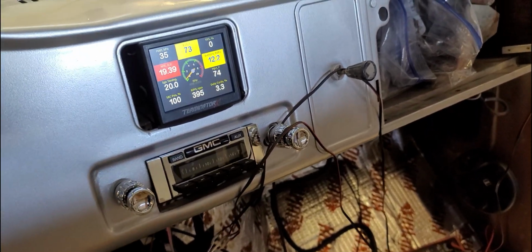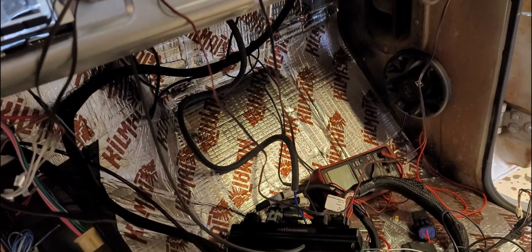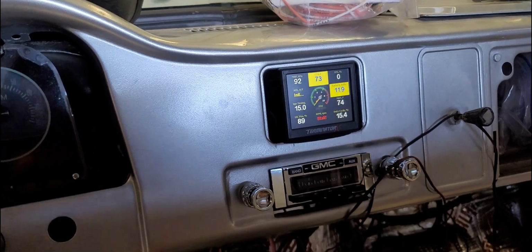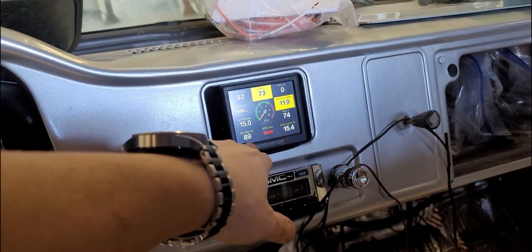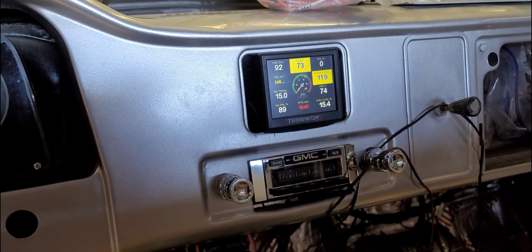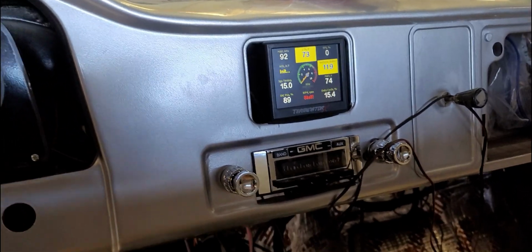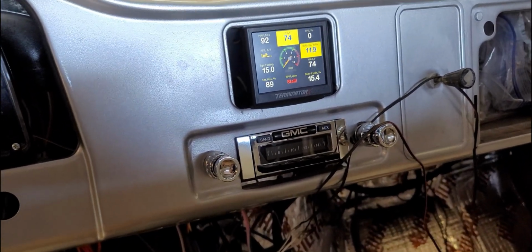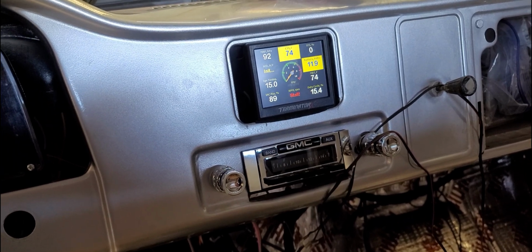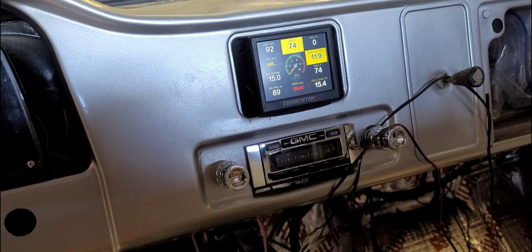All right. My hand was sealed on that throttle body to get it running. When it was running and your hand was over it, it opened the IAC to 100% and then went back down to 89. So I think that IAC is stuck. I think it's physically jammed. See if I can find an IAC. See if you can extend it, pull it out, extend it all the way so that it's closed. That's what I did. I put it in with it all the way closed.